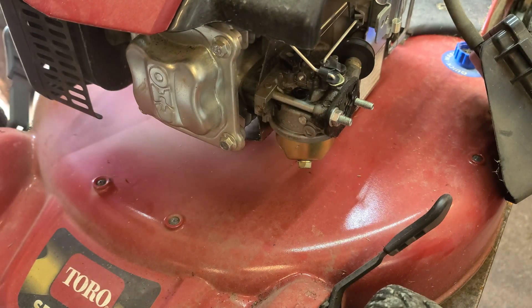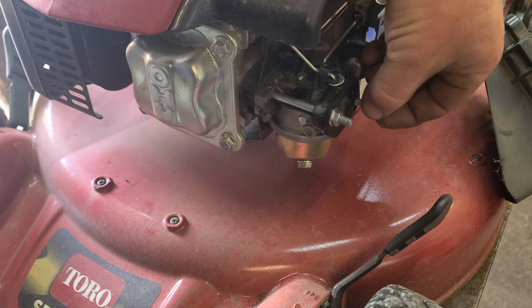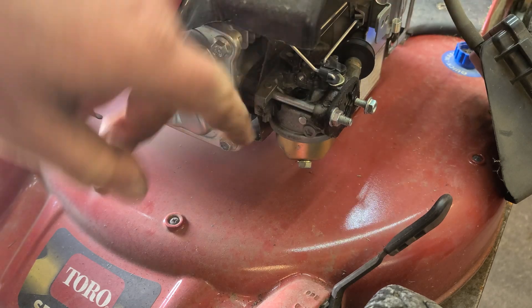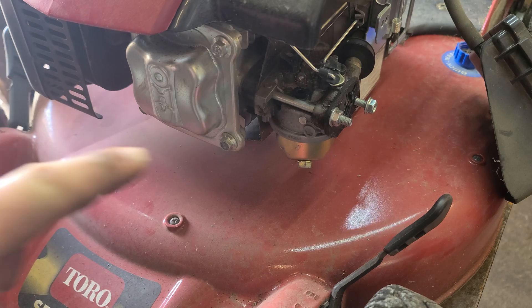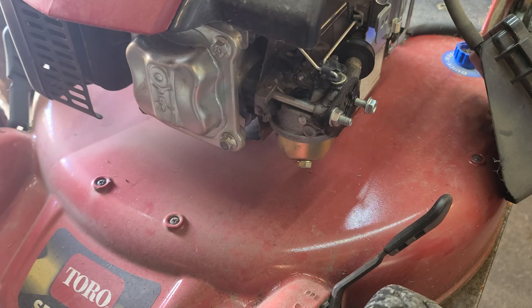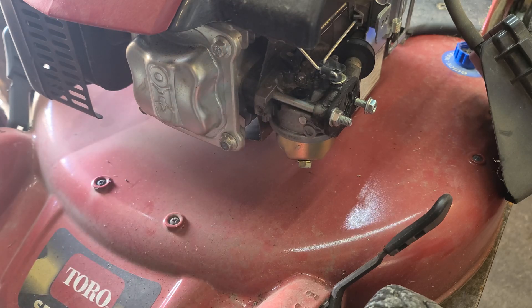There you go guys! We dropped one of our carburetor nuts — there it is. The problem was this little plastic jet right here. On any machine that has a Honda-style carburetor, this part is usually the reason they surge. Sometimes it's the main jet, but this one seemed to start easy and run well, which indicated this was the problem. So there's a tip for you guys — don't change a spark plug when it's a carburetor problem. We've done this hundreds of times and it's always this guy right here. Thanks for watching — subscribe for more videos about how to fix stuff like this.